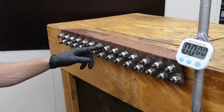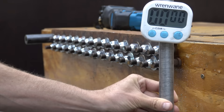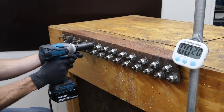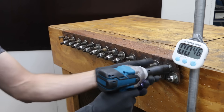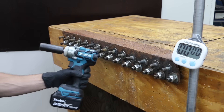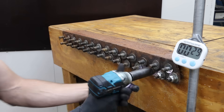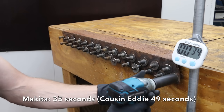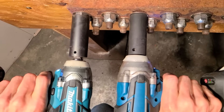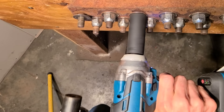The next test is a speed test between Cousin Eddie and Makita. All bolts have been torqued to 100 foot-pounds, batteries are fully charged, and both impact wrenches are in high-impact mode. Cousin Eddie completed the task in 49 seconds. The Makita completed it in 35 seconds. In a side-by-side slow-motion contest, the harder impact of the Makita and the faster trigger response made a huge difference in breaking free the nut and then rapidly removing it.